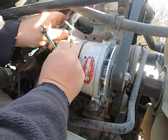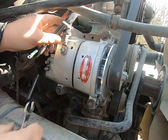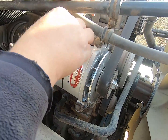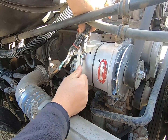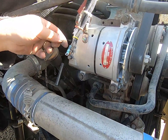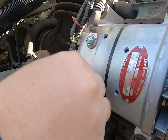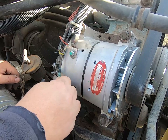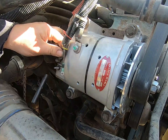Okay. There is a washer on there. It's a lock washer. Same thing here. Not tight enough so that you're going to strip it out or anything. You want to compress that lock washer. Now if you remember right, I did cut this end off and put on a new terminal, because the one that was on there was not a heat shrink, and I want a heat shrink to keep the salt from getting in there. Once again, these are tiny. Good enough.